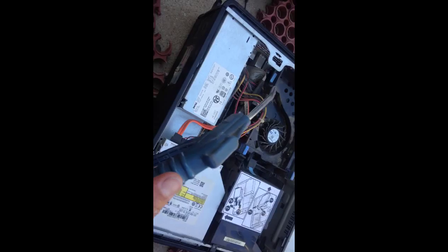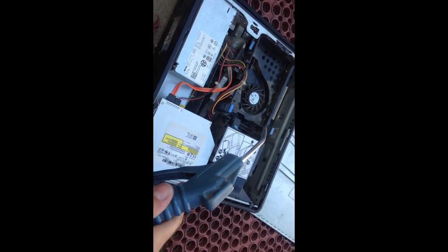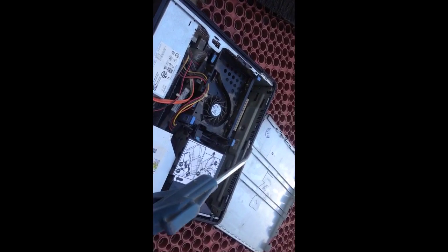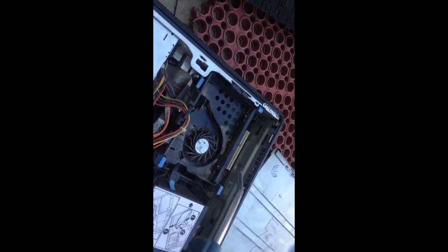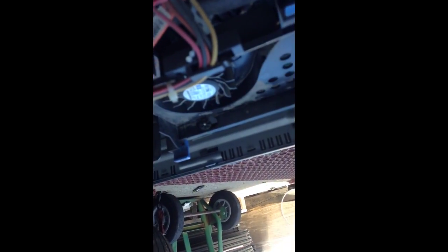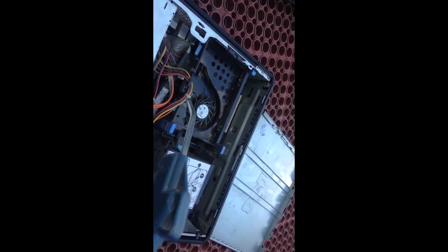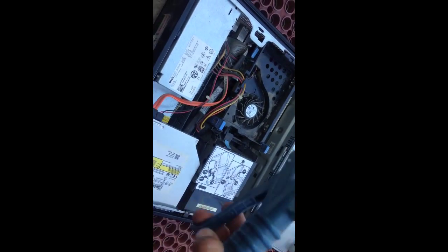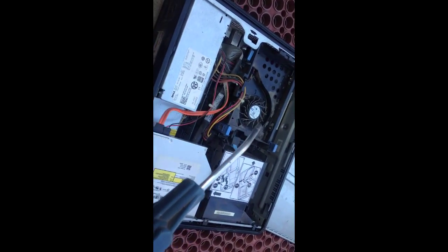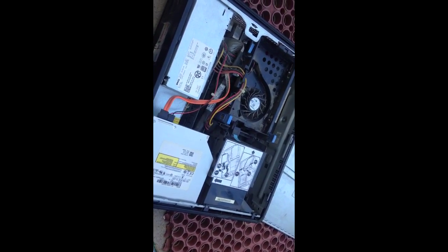When I start you're going to hear a blowing sound and you'll likely hear my air compressor kick on too. I just weave back and forth. I keep it about two to three inches above the actual computer because I don't want to nick a fan blade. I'm just going to blow around and when I'm done we'll have a nice clean computer and we'll just be able to plug it back in and get back to work.